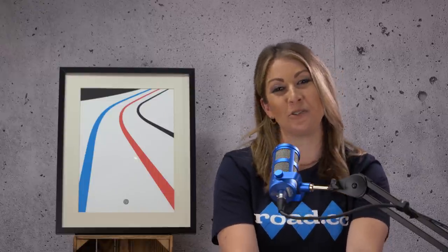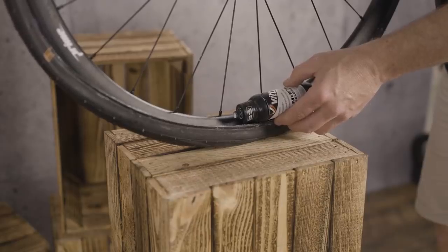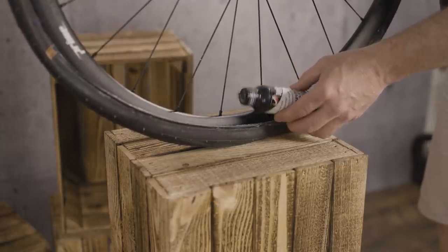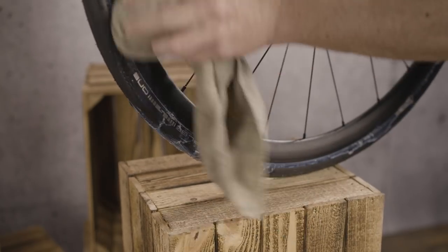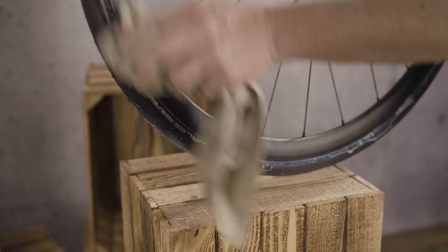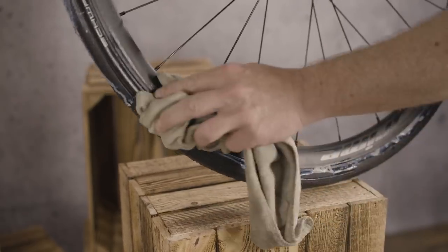When you do need to add sealant, there isn't really a foolproof way to do it. Yes, you can remove the core of most tubeless valves, but over time they love to get themselves gunked up with old sealant, and that can make removing the core a nightmare. Then, once you manage to get it out, most sealant bottles don't fit the valve properly, so you'll inevitably get some sealant dripping down onto the rim, tyre sidewall, and in the worst cases, down onto the carpet. There are specific syringes available for this job, but even those are prone to throwing sealant everywhere. This all means that you probably want to have a rag at the ready.